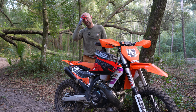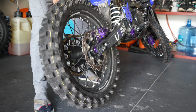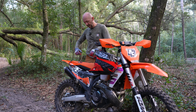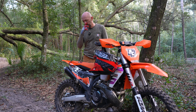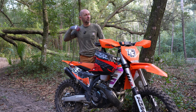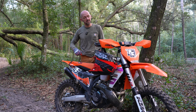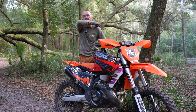One way to do it, and actually I have a chain right now on one of my Yamahas without a ring, so that's flying super easy. Less friction means better power engagement. You can have a quicker throttle response down low, especially on two-strokes. It matters. In my opinion, the best chain of all the bikes is the OEM Yamaha DID chain on my 250 two-stroke. It has little to no friction at all. That chain is something else, but it's extremely expensive.